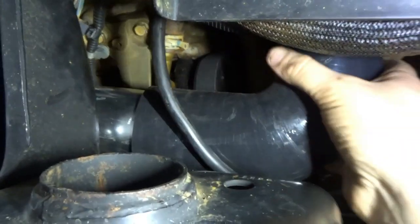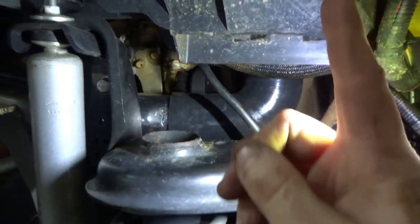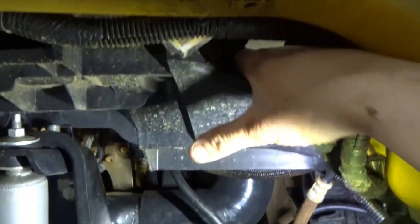I've already slid this tube on — I'll move it so y'all can see, I was just test fitting it. As you can see how close that is to your power steering. But once I tighten it, this right here comes over just a little bit and goes behind your brake line bracket. Test fit everything before you actually glue it, but once you get ready, you have to put Permatex on the inside of this per the instructions, then clamp it down. You can see it's sticking up, and it turns to go straight up where your new box comes in from the top and sets right there.